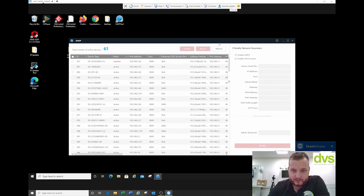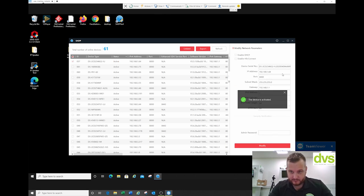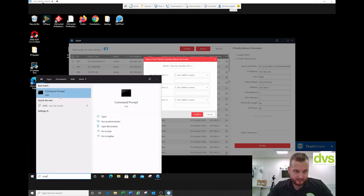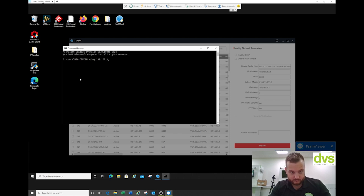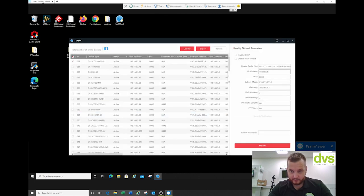Before we web browse into the NVR itself to continue the setup, what you'll see is this camera connected to the POE port is actually transparent on the LAN network — which is very different to standard plug and play NVRs that you'd use for a security application. So first of all we'll activate that very simply using the same password. Make sure the IP I set it on the LAN range is free — we'll do 29. So we'll set that as 3.29 and modify that.